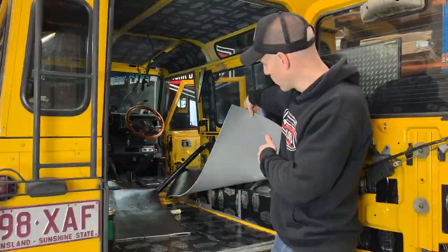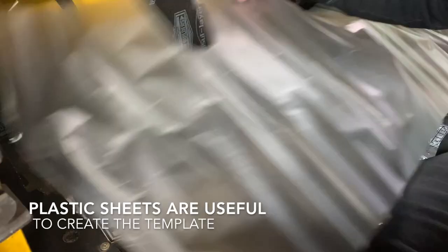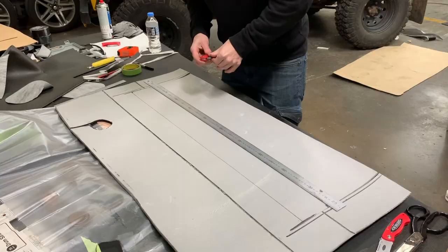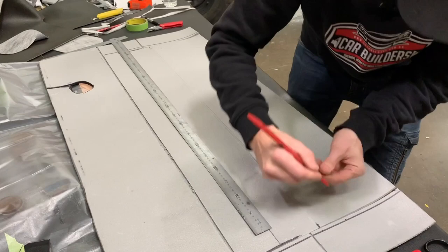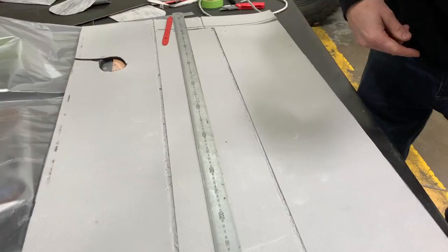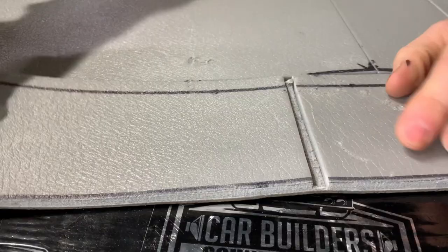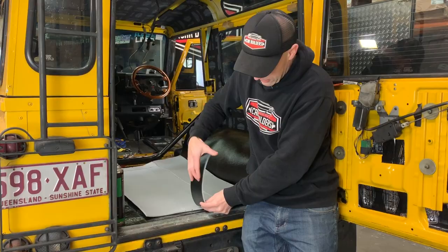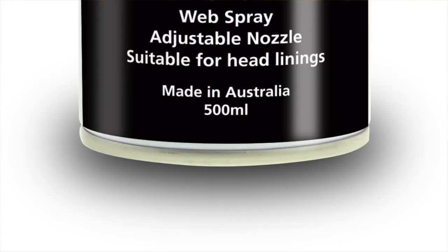So we're going to do some basic upholstery work - cut a rectangle for the floor and upholster the rear arches. With our rear arches in this car, there's a bit of shape here for the seat configuration, which has a negative step, and a couple of obstacles to work around. For basic patterning, here's one I've prepared for the left hand side - we've just measured out, worked through, and marked the back face of the sheet. A couple of tricks to get it to flow over surfaces: we've relief cut the foam, being careful just to cut through the foam and not score the material, then weave that foam out. When you fold this 90 degrees, it's not going to put the foam under compression where it wants to roll back out. Without relief cutting, it's almost going to want to come unstuck like a lollipop. So we're just relieving the tension before we put it on, and that should sit there forever basically.